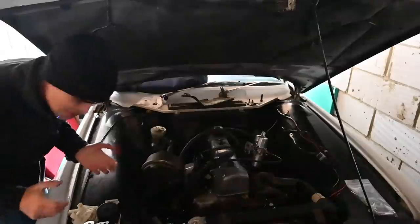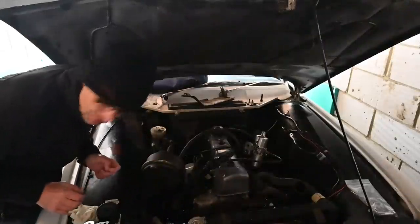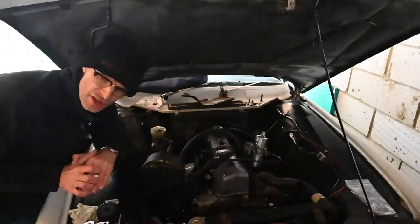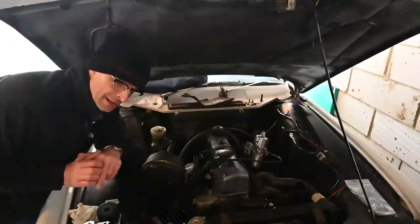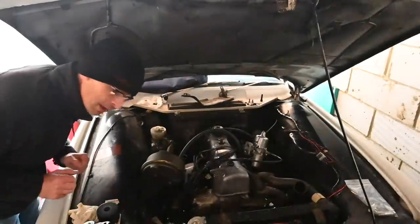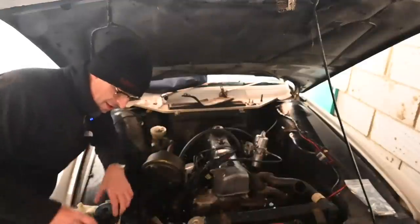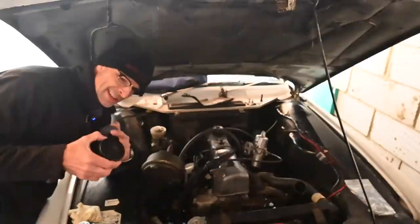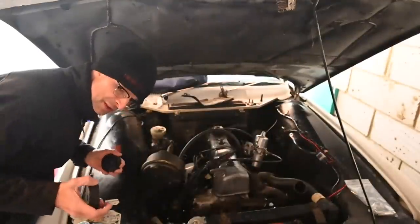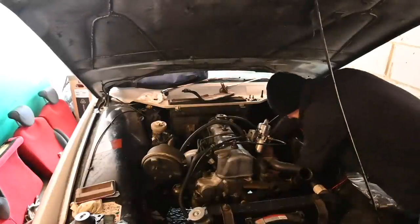It's kind of dingy in here, but hopefully this is the final leg — the last stand of doing this. I can't move the car back any further because the engine is supported on a jack, and there's not much room because I've got most of the interior from a pre-production or early production R50 Mini in here. Looking at the photo I took of these new mounts compared with the old ones — this is about the difference. Because I've done the entire hockey puck as one, if it's too high I can take it out and shave it a bit lower. If I cut them in half to start with, you can't go back — measure twice, cut once. That's them in. The engine is now raised up.